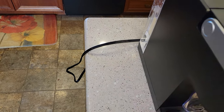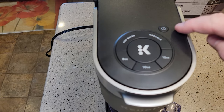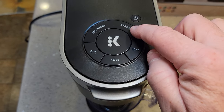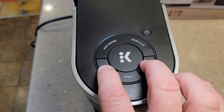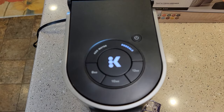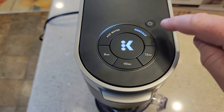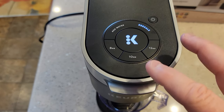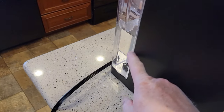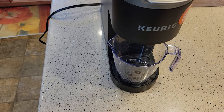We're going to leave the machine plugged in, but we're going to turn the machine off — make sure the machine is off. With the machine off, we're going to press the 8-ounce and the 10-ounce buttons together until the descale light lights up solid. Should be about three seconds. The descale light is on solid now and the K button's flashing. Press the K button — even though we're not going to touch the power button, the power button's not going to light up. This is called descaling mode. Press the K button and that's going to brew the descaling solution through the machine. It's going to come out here, so make sure you've got a container to catch it — we're just going to throw that away in the sink.